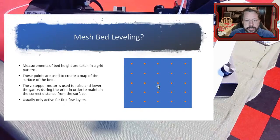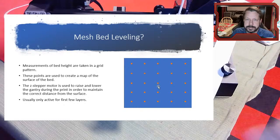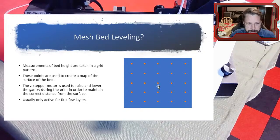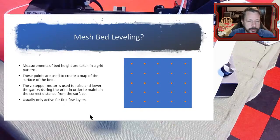If one side is high, you might just adjust the whole bed with the leveling knobs before printing - you should get it as level as you can before starting. One thing about this bed leveling: it's usually only active for the first few layers of your print. The entire print doesn't have to adjust for bed leveling - it kind of fades out as you get three or four layers in. I didn't check what this particular firmware coded as the number of layers.